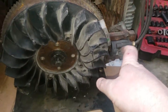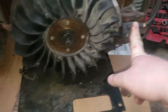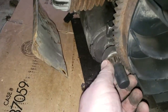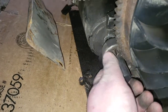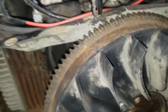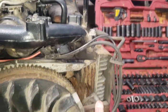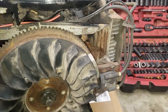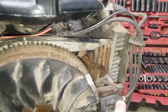You need two hands to remove the shroud. I like to remove the coil just to get it out of the way of the flywheel. You can also remove your starter if it's in your way — this will give me a chance to check out my starter and figure out why it's grinding so much. It looks okay where it contacts the flywheel teeth. It's a good idea to remove the coil; you don't want to have to go buy a new coil just because you slipped, hit it, and snapped it off.